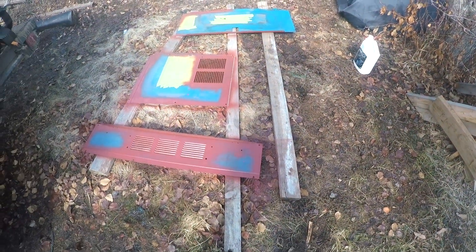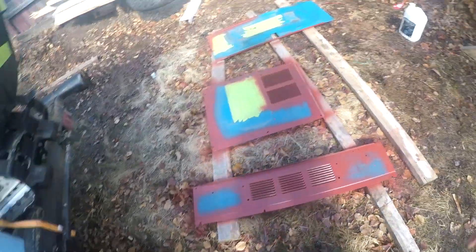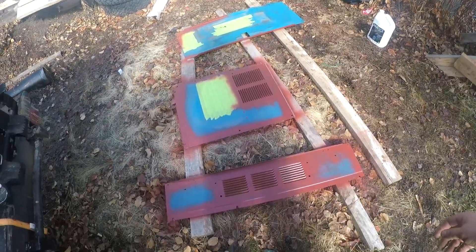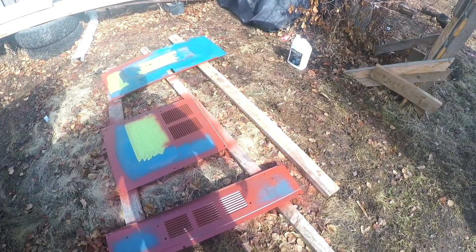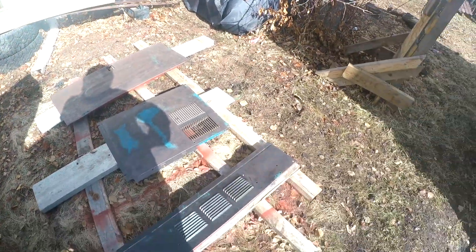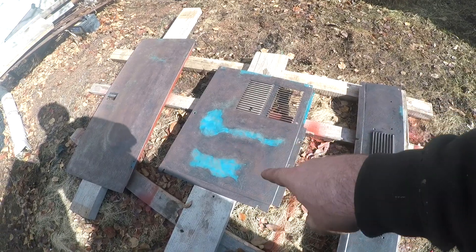There's the bottom sides of these panels, the back sides — just areas around the back, around the screen, around the edges where the rust seeped around the back side. Wire wheel those off and wipe them down with wax and grease remover, prime the edges, let those set for a minute. We'll flip the panels over and prime the outside. In the tarp shed there's a big top hood that's primed and ready to go as well — they got a rigorous wire wheeling and then I wiped them down a couple times with bar soap. That's where the Miller sticker was.